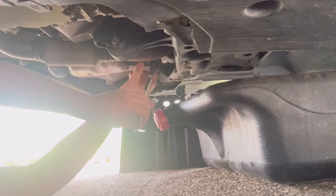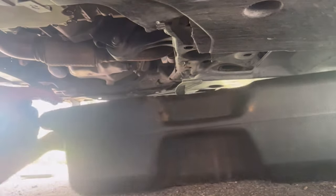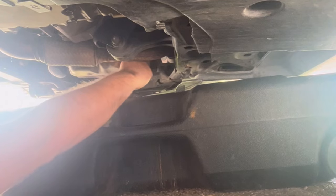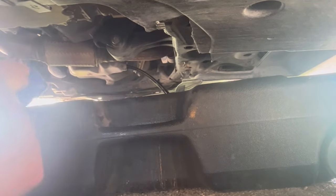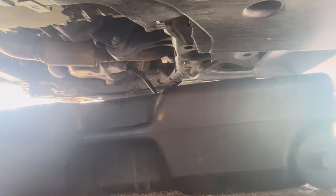Oh man, it's still tight. But these ramps — I don't got a shop with a lift and all that nice stuff, so maybe we'll get there one day. Position the drip pan and then just take it off. Let it drain. There's not really a reason to wait. Another reason why I use big drip pans is because the filter is right there, directly behind it. So I'm going to move my pan over — it's still going to be catching the oil — and go ahead and start taking off this filter to save some time.